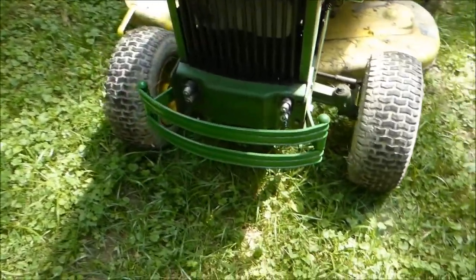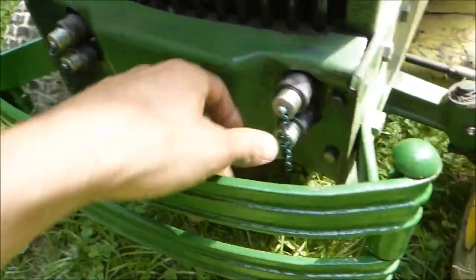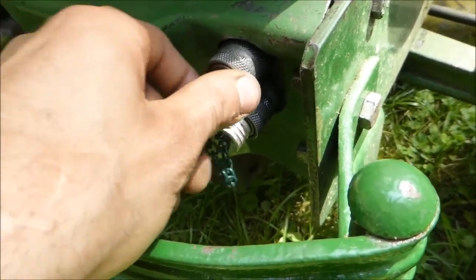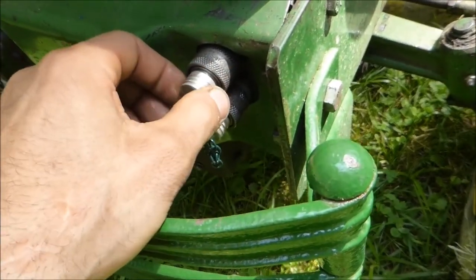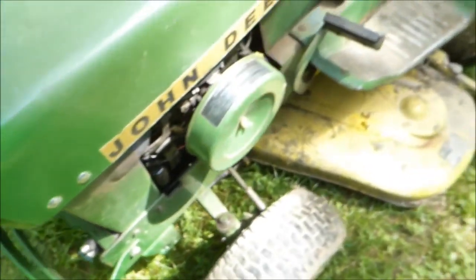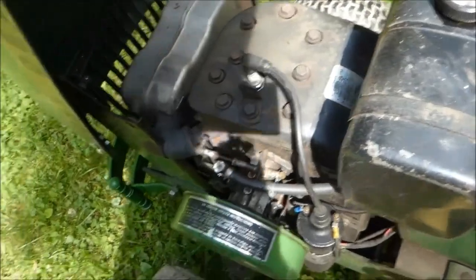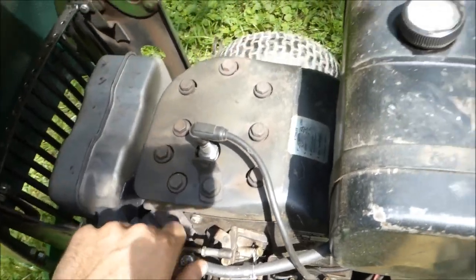Alright guys, it's all finished up now. Got that bumper done — looks good, just bolted it on there. I made these plugs on the lathe; they look good — pretty easy job. I just had to make sure they were locking in all the way. Had to turn a couple of them down a couple of times cause they weren't fully locking — gotta make that groove wide enough for the balls to sit in. Put a little fuel shutoff here on the fuel line, cause the carb seems to leak sometimes when it's just sitting. It's got one on the tank but it's too hard to get to, so I put one there — nice and convenient.